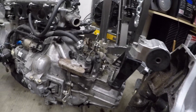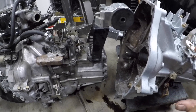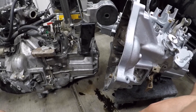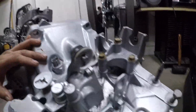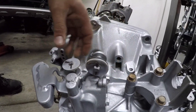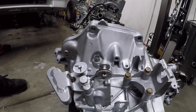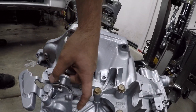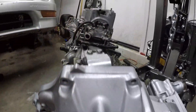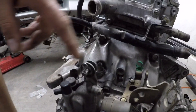The other thing is the starter — the front-wheel-drive and all-wheel-drive starters are the same, so I won't have any issues with that. Let's look at this guy here — the shift linkage. I'm sure it's important to get the car into gear. On the all-wheel-drive this is held in by one bolt, but on the five-speed it has three bolts. So I plan on moving this whole piece onto this transmission.